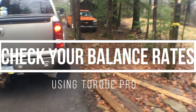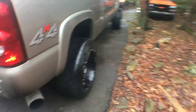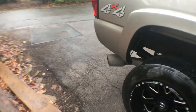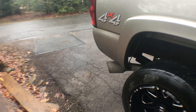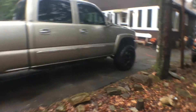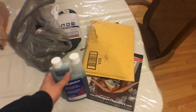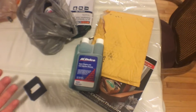This is the reason why we're doing this — all the tests and changing out and cleaning the injectors and stuff like that. See that haze there. It's a little bit more when she starts up lately. This is more of a recent thing. This is my truck. I've been having some problems with my Duramax. I've been getting a haze at idle and white smoke issues.